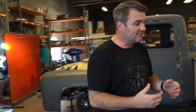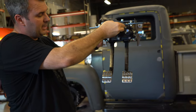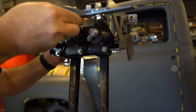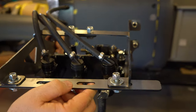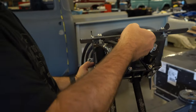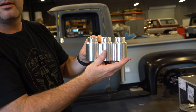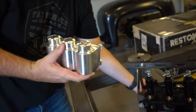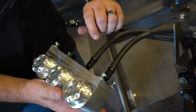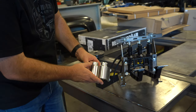What we've come up with is a kit that uses the Wilwood pedal assembly — clutch and brake — with the reverse mount master cylinders. We've installed and designed a bracket to hold all of that, which can either mount to your firewall or be welded in if you get this done ahead of time. This billet piece right here will mount to your firewall, and you'll get these lines where you just drill a little hole with an O-ring and feed those right through to the master cylinders.